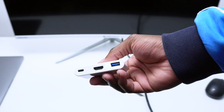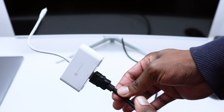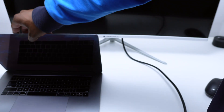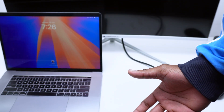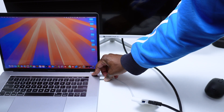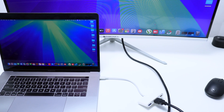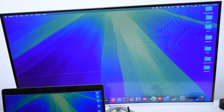Next, connect the other end of the HDMI cable into the Type-C to HDMI adapter. Now open up your MacBook before you connect it — it's very important to have it open first, otherwise it might not be recognized. Unlock your MacBook and then plug the adapter into the Type-C port on your Mac. Here we go — it's connected, and it already recognized the monitor on the external display.